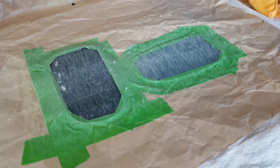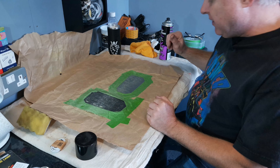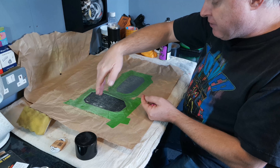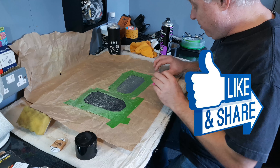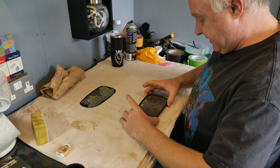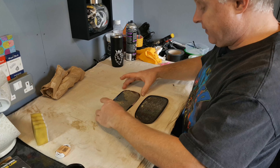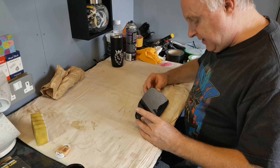Now leave that to dry. If using the 3M product or the Tessa product I was mentioning, you would leave them for about five to ten minutes. The point behind having the mirror and the backing perpendicular to each other but spraying across in the same direction is that when you bring the parts together the glue will actually have a crisscross pattern between the two parts, and by doing that you will get a better result. Once you've left it to dry for a sufficient period - usually when you can put your finger on it and it doesn't try to lift the item off the table - holding the edges very carefully, bring your glass and using the technique you practiced earlier, drop the glass into place in its frame.